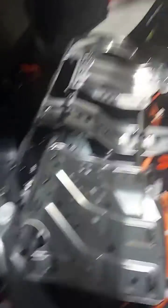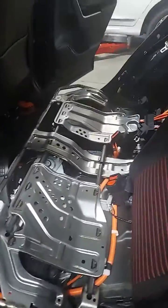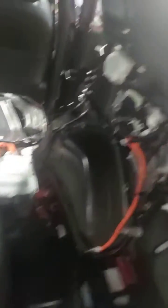I know it looks a little scary in here right now with everything kind of taken out, but I had to pull all that stuff out, test all the wiring and things like that, make sure all your hybrid system is good, your battery is good. I pulled this all out and tested everything, tested all the wiring, to make sure we don't have a short somewhere. But what I ended up finding is everything popped on because your 12-volt battery was no longer charging.